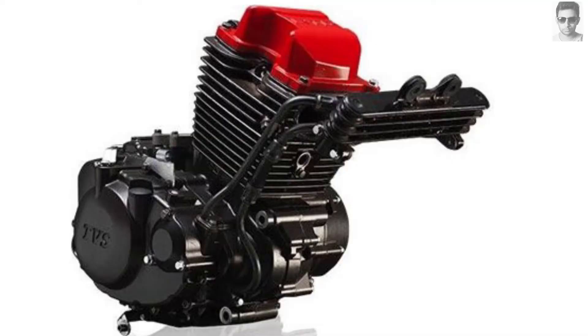You can see this picture — this is an oil-cooled engine. Mostly it is an air-cooled engine with just a small addition of a small radiator. The oil comes from the engine through inlet and outlet pipes to the radiator, and then with the help of air it loses the heat, cools down, and the cool oil goes back inside the engine. This is the process of oil-cooling — it is just an air-cooled engine with small changes.